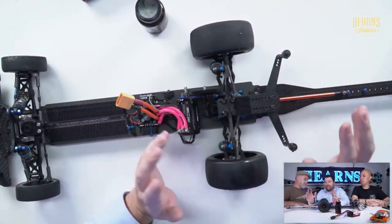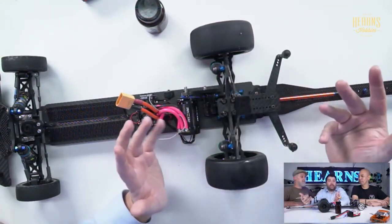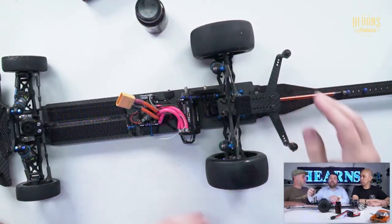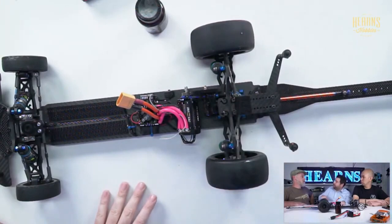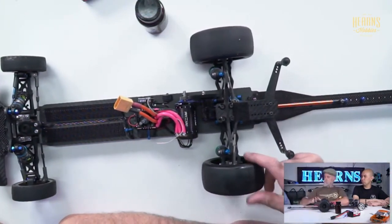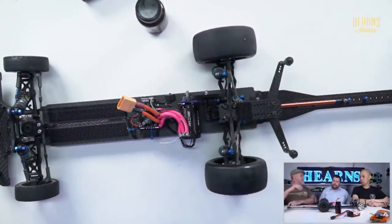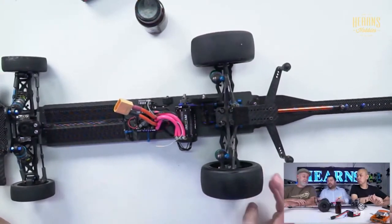Some people use a rag or whatever you like. If you're not prepping your tires, a really good tip is to buy a doormat from Bunnings for about $10, put some water down on it over the space where your wheels are, and do a quick little burnout in the water. When I say quick - not full power, just enough to agitate the surface of the tire. And there's one step above that, which is Simple Green - burn out in Simple Green instead of water.